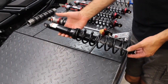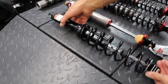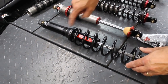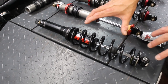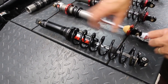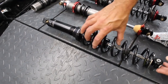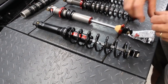We're a big Elka dealer here — great engineering relationship with them, fantastic shock absorber. We sell primarily Elka as well as modify OEM shocks. We've also got some KYB and Walker Evans on the table to show some OEM options. This is a stock shock absorber off a 2022 Ski-Doo MXZ X package — a very basic shock absorber. It is serviceable, as you can see by the nitrogen fitting on top, but we can't get to a zero preload situation with this adjusting mechanism.